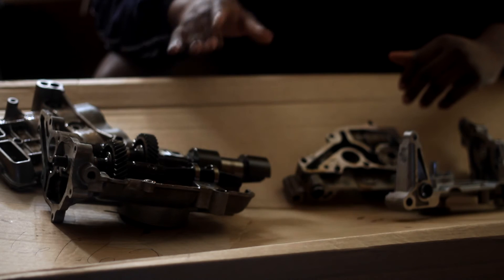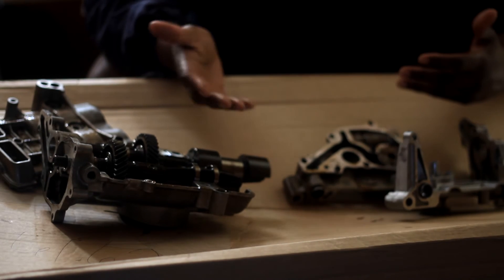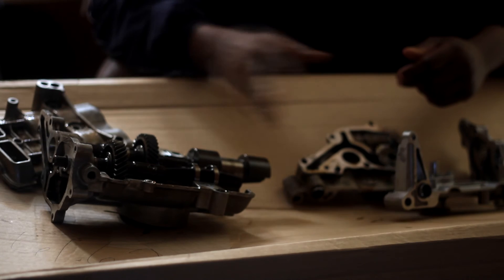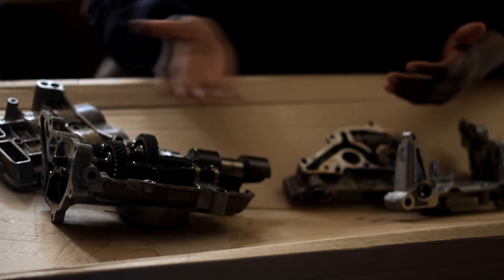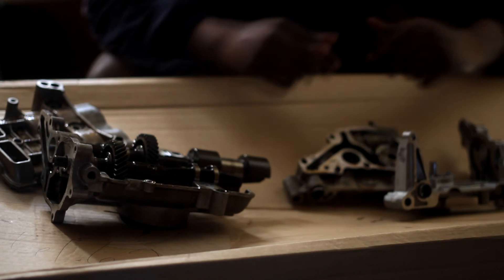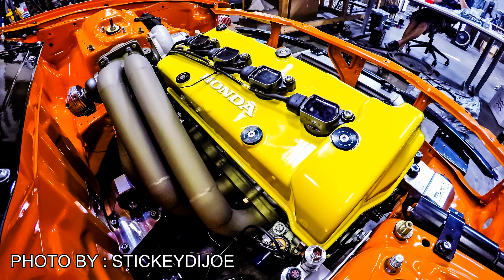When it comes to oil pump and oil starvation, there's so much you can do with a wet sump setup. Anything crazier, you probably want to go dry sump, which majority of the supercars out there are rocking — Lamborghini, McLaren, whatever. Most of these cars are dry sump, so there's not really an oil pump or pan on the crankshaft's rotating assembly. I think HPD has a dry sump setup. I think Wire Wire has it on his K24 Integra that he had at SEMA. I don't think I need to go that crazy — it's expensive.